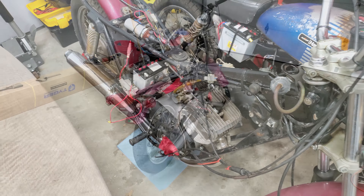I grabbed these lights because I know some models require the headlight to work for the whole ignition system to function. The previous owner said he had the headlight going and then it stopped working and he just stopped there. So I put the indicator lights back in because I don't know if those play a part either. It's possible the headlight works through the left switch — maybe that's why the horn and everything is not working. The orange generator light should be lit up and then go out when the generator is charging, but it's not on, which makes me feel like we might have a headlight issue.